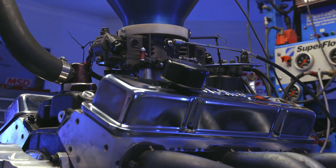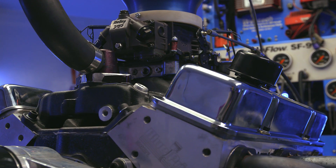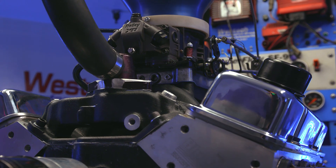So let's recap the data we just saw with that 650 CFM carb: intake manifold vacuum at wide open, 1.8 inches of mercury; 600 CFM at peak airflow through the carb hat. It made 479 pound feet of torque and 470 horsepower. So I'm happy. That's a great baseline — great engine. I'll be happier when we get a bigger carburetor on.